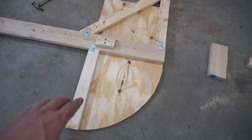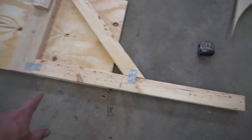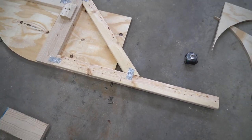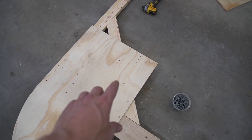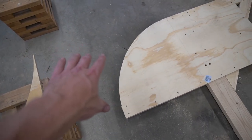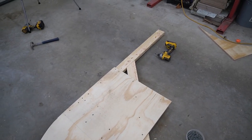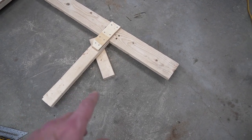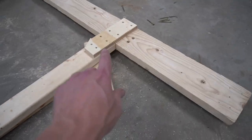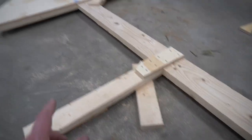Over there's the leg. Here is where the tipping action is going to happen. We put a 45-degree brace there — about three feet long — and then this is a four-foot piece that gives the car a nice base to sit on. Going to flip it over and put some screws in that plywood for extra strength. I also changed my mind and moved the leg from being screwed to the front to supporting it from underneath, using plywood scraps to tie that together. Going to put a brace this way as well since I don't have plywood on that side.